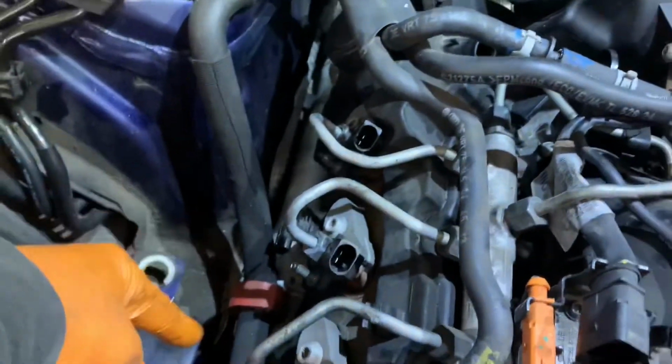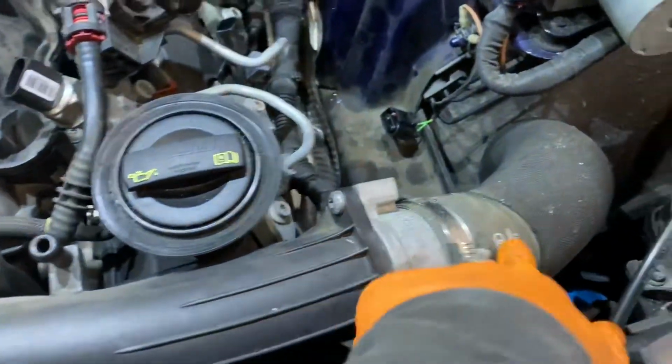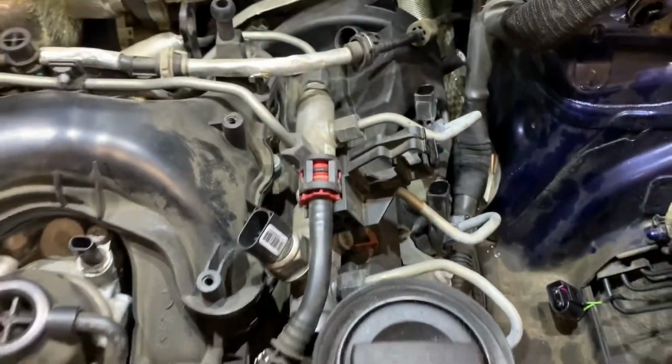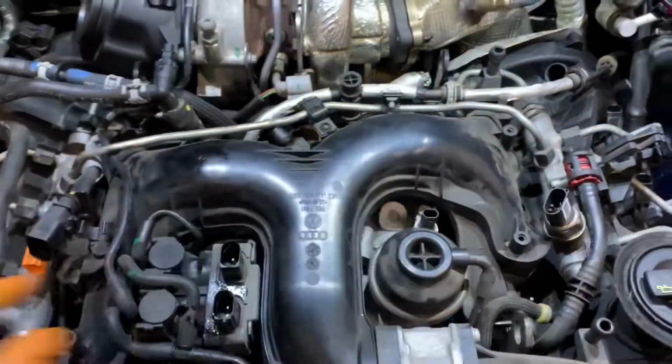Right, so I've removed the coolant tank: connector on the bottom of it, 2 10mm nuts, a few pipes on the top, and the spill off tubes on top of the injectors are taken off now. So with them out of the equation, I've disconnected it from the blow valve here. Now I'm going to look at getting this boost hose removed and getting this piece out of the way. It's moved. There are some connections down here that need to go. Then we'll start stripping off the high pressure lines so we can get access to get this off.